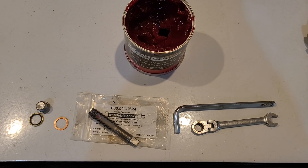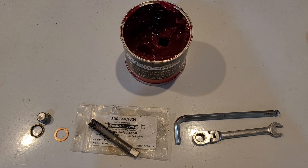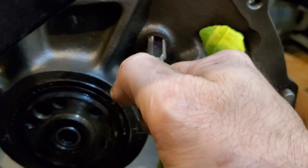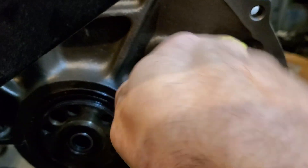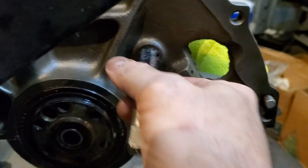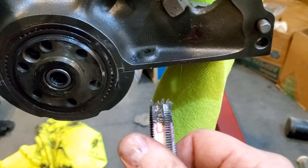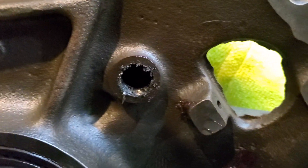You don't need a drill — just run the tap right through it and deep enough that you can get the plug in there nice and tight. The tap fits in there perfectly. I've already gone through there and tapped it — a little bit back and forth to get the job done. When you get it out, as you can see, the grease picked up all the bits as you were cutting. That's one of the reasons you use grease, other than obviously to help lubricate it. As you can see now, we've got nice clean threads there, and now we're going to have to clean up.